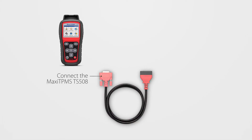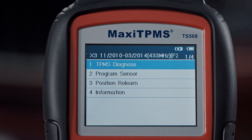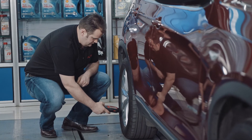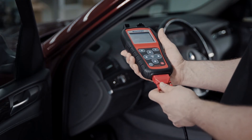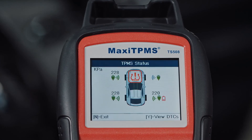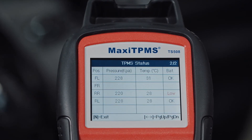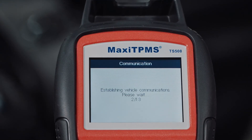To perform complete TPMS service in Advanced mode, we will need the OBD cable to connect the TS-508 to the vehicle. For TPMS Diagnose, follow the on-screen instructions to activate all the sensors. When all sensors have been triggered, the OBD Diagnose option will appear. When connected to the vehicle via the OBD 2 port, the TS-508 can access the TPMS module to read and compare the registered IDs with those activated at the wheel, retrieve system codes, and the status screen enables the technician to identify at a glance the cause of the TPMS error and see if the module contains codes too.